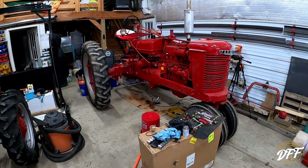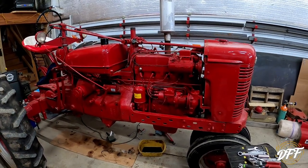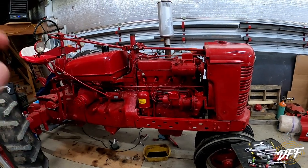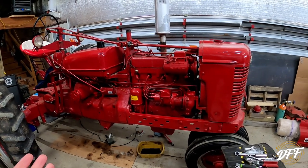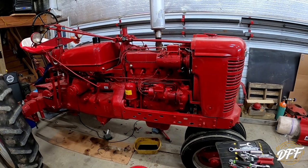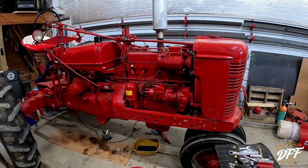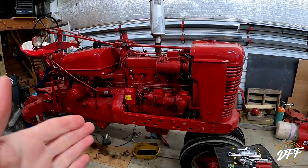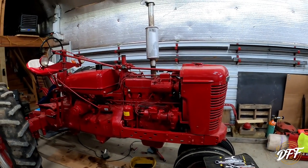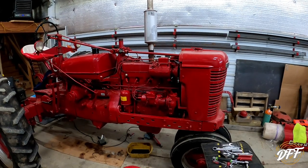So the tractor's running and the next step I'd like to do — in the last year or so working on the tractor — I noticed we still have an oil pressure issue and there's some sludge built up on the interior of the engine. So what I'd like to do is run a kind of a sludge remover engine cleaner through it. I don't know how well those products work but I thought I'd try it anyway. We're going to do that first, then drop the oil and the oil pan. I believe there's a suction screen and a pickup tube in there — we'll take that off, clean it up, and see if maybe that'll help our oil pressure issue. Then we're going to put a different oil in it than last time. I put straight 30 weight in last time and we're going to do something different. So let's get started — we're going to warm the tractor up and then get our sludge remover in there and run that. I think it says like five minutes and then drop the oil.